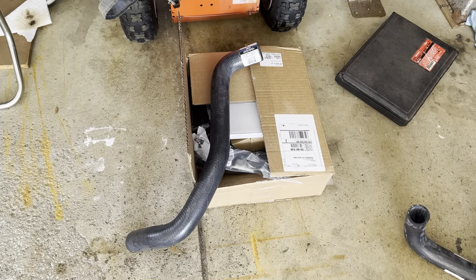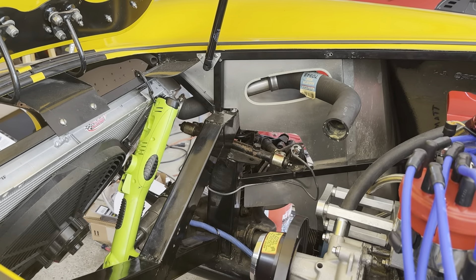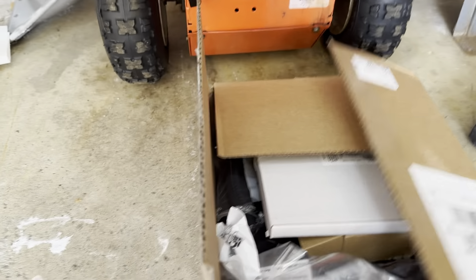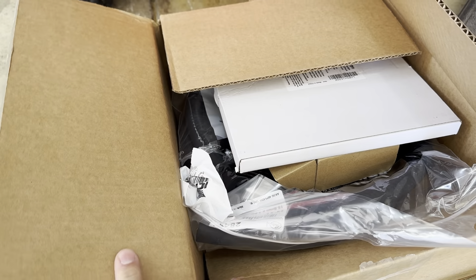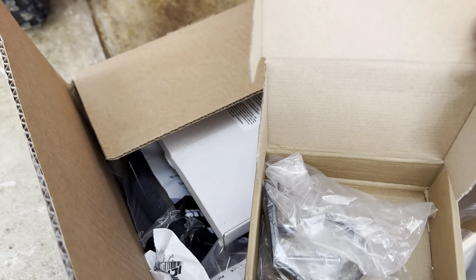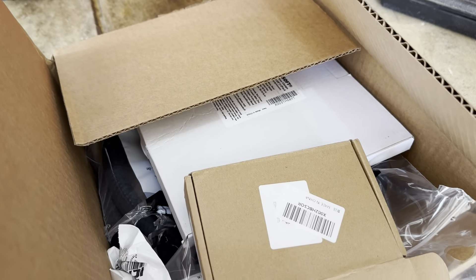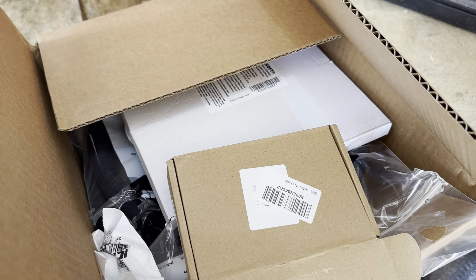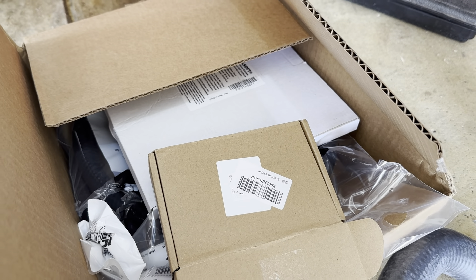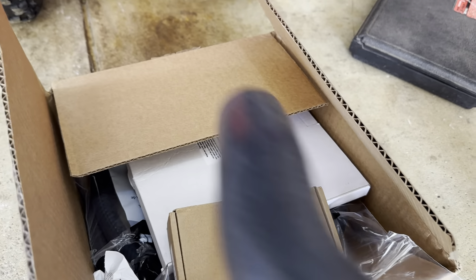There's also the upper hose — same part that's already on the car but it has a splice in it — meant to work with the overflow tank, the purge tank, whatever you want to call it. I've got my clamps, some heater hose, and a Ford distributor coil clamp meant to mount to the head, made for more classic Mustangs. So I've got a lot of stuff here to work with and hopefully I can get these parts and systems resolved and get this thing back together.